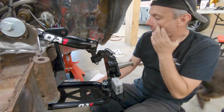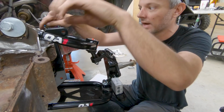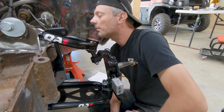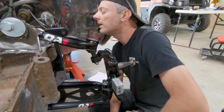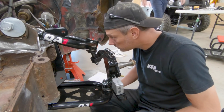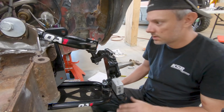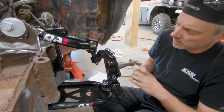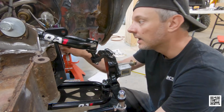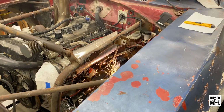All right, we can weld it in. I wish I'd have maybe pushed those back in a little bit so we would have more adjustment there. But actually, you said you had a plasma cutter, right? I do. Yeah, we can just plasma cut that little lip out of there, and then I can get another 1/4 inch down. And that may get us a good sweep where we're gaining camber the whole way. Anything we gain now only makes the stuff better. I'll get the plasma cutter.